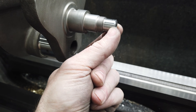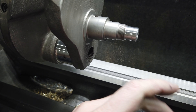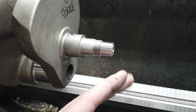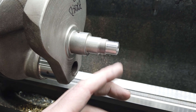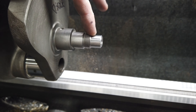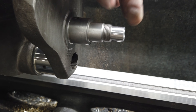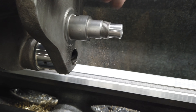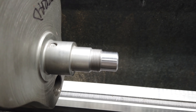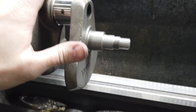I did have to trim up the feed end on this because somebody had hammered it out. From about a quarter inch in it was still good, still standard - right on the edge of average standard on these. I was kind of fearful to do it in the crank grinder. I do them a lot in the crank grinder, but because it had already started to wear further up I didn't want to risk removing more material there. So I put it in the lathe and just trimmed it right on that damaged section. Luckily that worked out really well, then I sanded it with 1000-grit to make it nice and pretty.